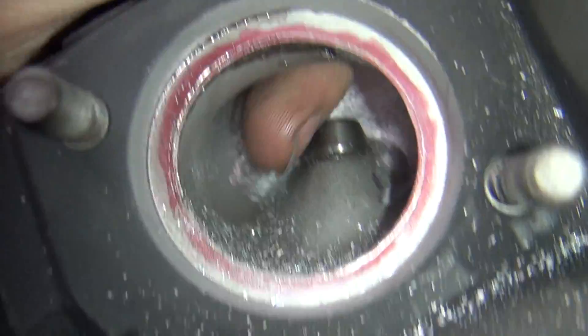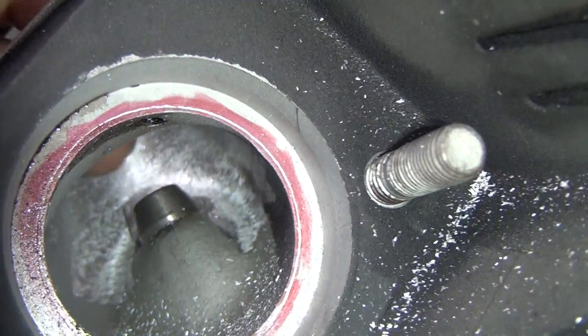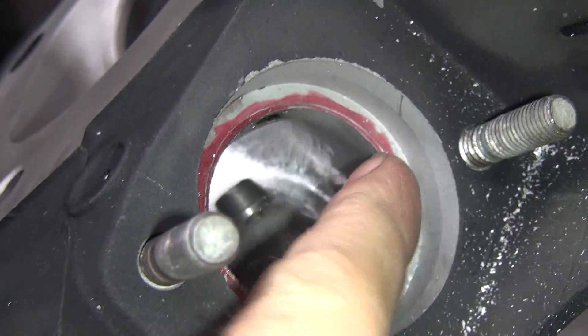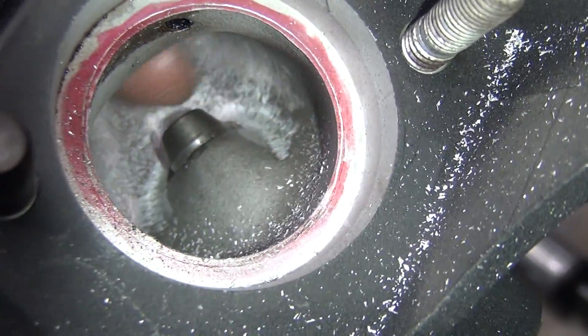I haven't gone over this side yet. There's not a lot to be done over here — it's just a matter of bringing it out a little bit to your gasket line and cleaning it up the rest of the way. The port's pretty round and open on these heads, so there's not much to be done on exhaust. Once you get the bowl opened up and cleaned up around the valve guide boss a little bit, you're pretty much done.